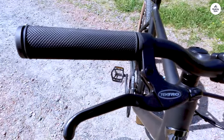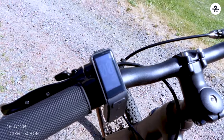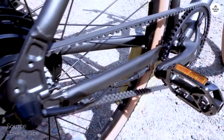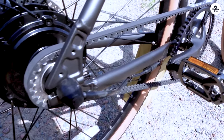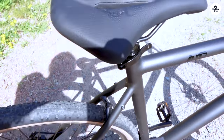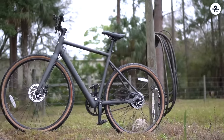The handlebars are extremely narrow and are uncomfortable due to hand positioning and the riding position you have to assume with them. My wrists are often bent inwards and fatigue pretty quickly on the ride. I'm planning on swapping the stock handlebars out for a Surly Corner Bar, which will give me the option to be in a downward drop bar style position or a more upright flat bar position.